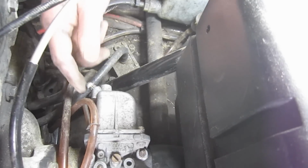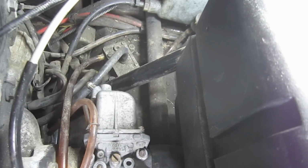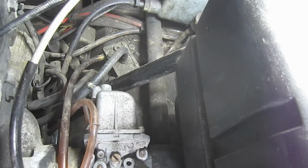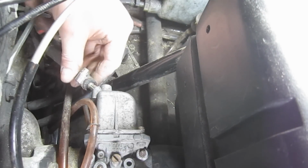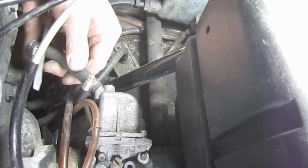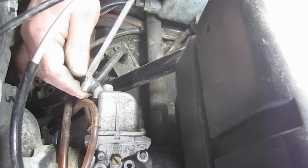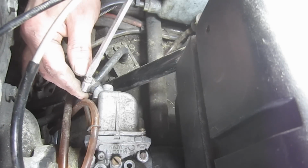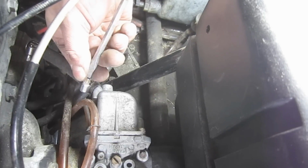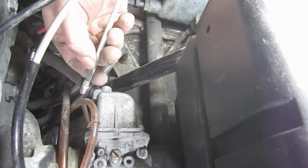Okay, so what I discovered was that this tube here, which I don't believe is an overflow, I'm not exactly sure of the purpose of it, was split. And on the bottom of the tube it actually had a stopper, so I'm not entirely sure what the purpose of this is, unless it was a way to drain the float bowl. If somebody knows what this is, tell me. Leave a comment. Luckily I had some spare fuel line around, which is much more rugged than what was there. And I'm going to use a real clamp on it.